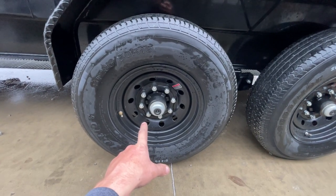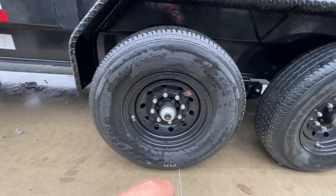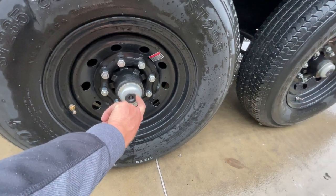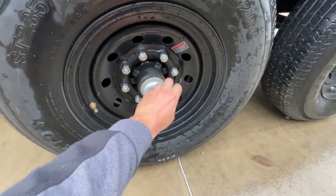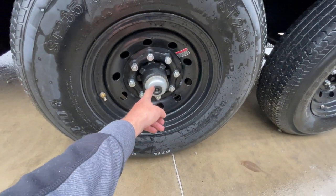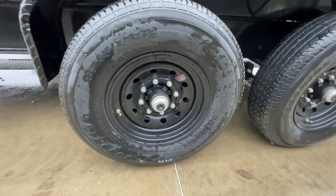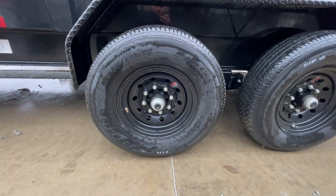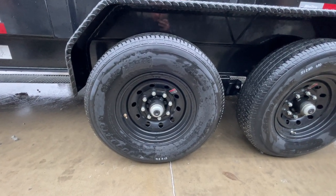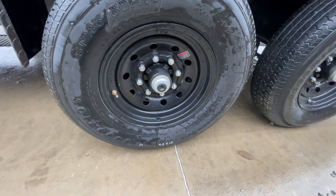One thing they do on this as well — it has a heavier 9/16 stud. Industry standard would generally be a half-inch stud. If you're going to carry a torque wrench at all, you would need a 7/8 socket on your larger nuts. This has the Dexter Easy Lube axles. If you're a homeowner that wants to do your own bearing maintenance, a lot of times you can get them out with just your finger — just take a flat-bladed screwdriver and pull that off. Behind there, right where that black nipple is, there's a greaser, so you can do your own maintenance. This also has the newer-style forward-adjusting brakes. They're similar to a car — they self-tension all the way throughout the life of the pad. This has a metal valve stem instead of plastic, which is nice.